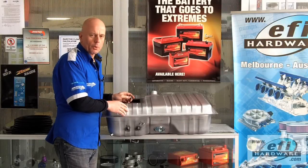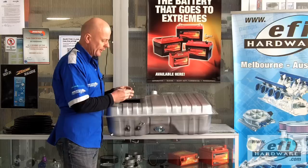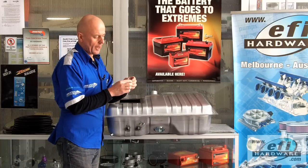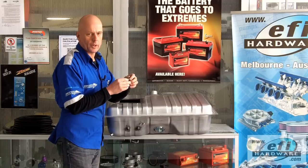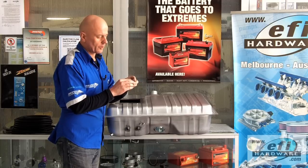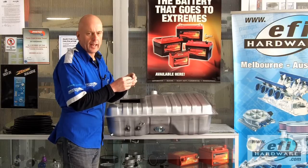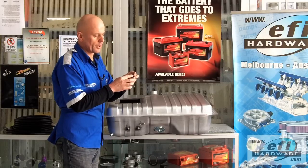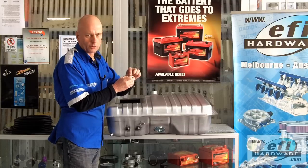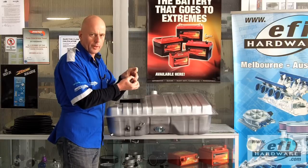Another very important key component of an EFI system, whether inside or outside the tank, is a good quality hose clamp. An EFI rated hose clamp has a shoulder just underneath where the pinch bolt operates. Without that shoulder, when you do up a high pressure hose, the potential for it to pinch and relieve some of its overall pressure around the periphery is increased. The shoulder eliminates that and gives a nice consistent clamping force right around the hose.